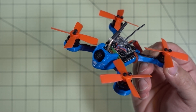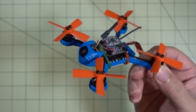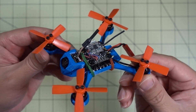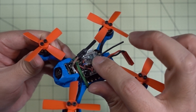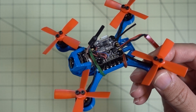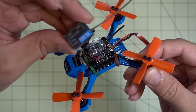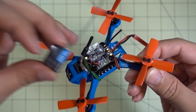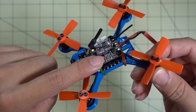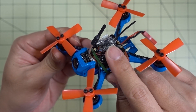Okay, so here it is all completed. It was actually really easy — it only took me about 20 minutes to swap over the parts. I did change the receiver; I'm not using the A8S anymore. I went with a smaller receiver and it saved a little bit of weight. The old receiver was on there before, and now I'm using the RX2A Flysky receiver. It still does IBUS and still works with my Eternity Evolution.